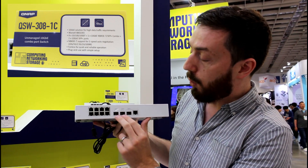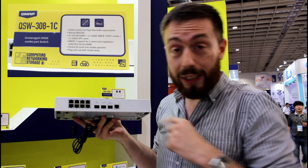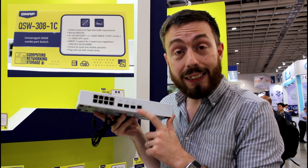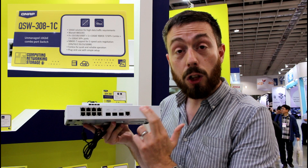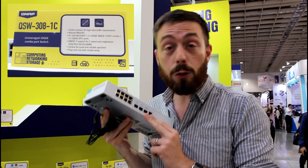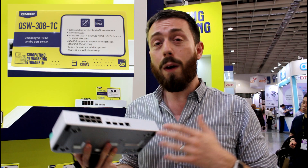Next to the 1GB ports, we've got three fiber 10GB ports. It's worth mentioning that the reason it's called the combo device is that you've also got 10GB on a copper base — so you have both fiber and copper. On those two ports you can combine them together for much better speed in your local area network. If you have a mix of 1GB and 10GB devices in your storage environment — home, business, whatever — you'll see enormous advantages here, without needing 8 or 12 ports of pure 10GB that many users won't fully utilize.